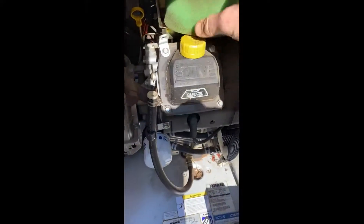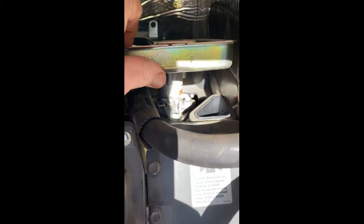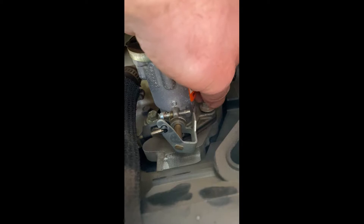I had this little cover on here and I was shaking this plate around trying to get it off, and then I noticed down inside that one of the bolts on the carburetor was loose. I can literally shake this thing around - I've got a video of it. The carburetor is sucking air in and I can see this bolt isn't even screwed down. You can see a better view - this is literally how loose it was when I found it.